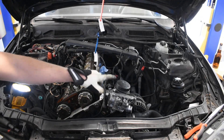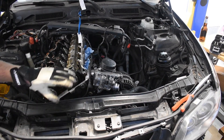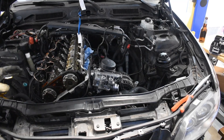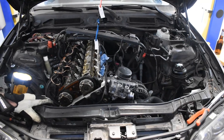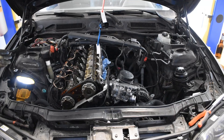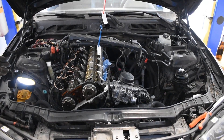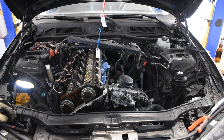I already went ahead and pulled off the oil filter housing, replaced the gasket there, took it all apart, cleaned all of it, and so that's all good to go. Right now we are working on the valve cover gasket. There's a bunch of oil that's been dripping down the side of the block here — the number six ignition coil had a lot of oil on it. So I think there's a pretty bad leak at the backside of the valve cover gasket.